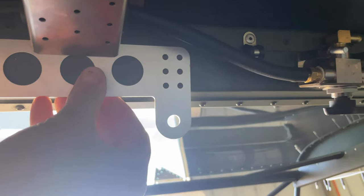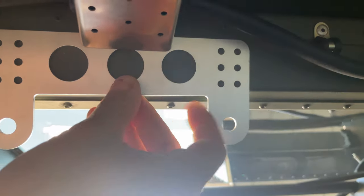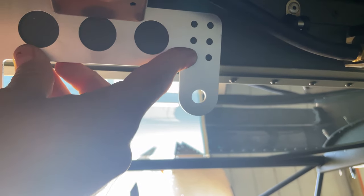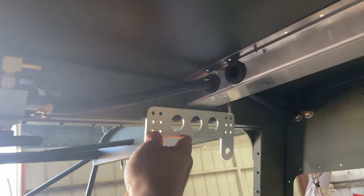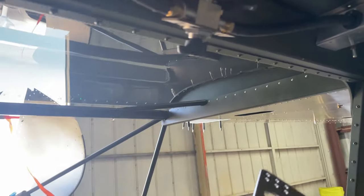We have the panel in now, so this has got to go in between. I've got to trim this piece back a little bit so we can get that mounted — actually not too much, it almost fits perfect. What we'll do is get this all lined up, get it in place, drill out the holes, and get those A6 rivets in place to get those mounted. And now I'll have my four point harnesses. This one might need to be trimmed over here just a little bit — we'll have to sand that back just a little bit more to get that piece in there.